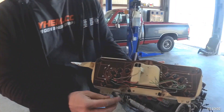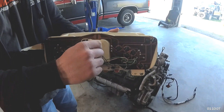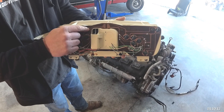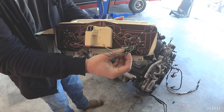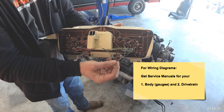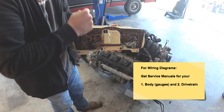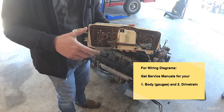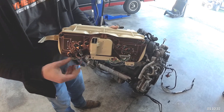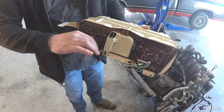When you pull a cluster from a salvage yard, you'll notice where the cable assembly used to come through with a big lock nut — that's now replaced with a large white box protruding out of the circuit board. The wires connect here; the blue wire is the vehicle speed sensor wire. You simply hook up a wire to your harness and you have an electronic speedometer. The bulkhead fitting on the D-150 hasn't changed much over the years.